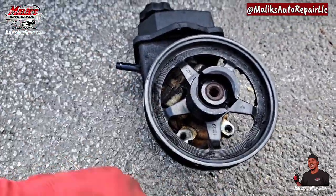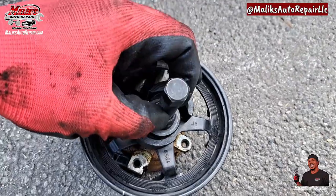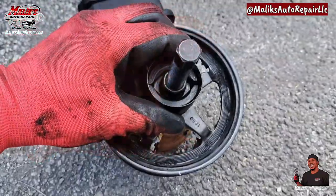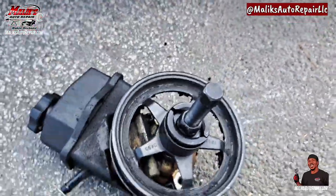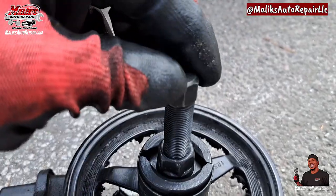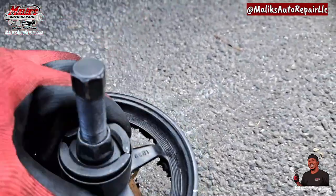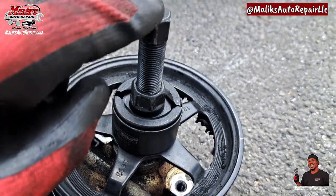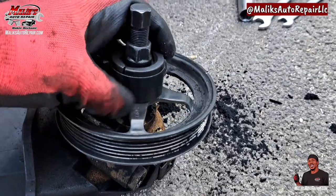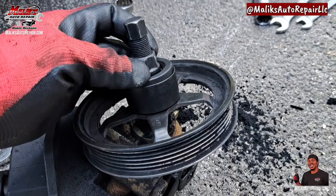You want to get this nut and bring it down like that, then put it up in there and that holds it. Then get your sleeve and put it on. You want to hold this and turn this - this is gonna push it out. I held that and turned it with a 21 millimeter on this nut and a 16 on this one. Righty-tighty, lefty-loosey - you want to turn it to the right to push it right off.